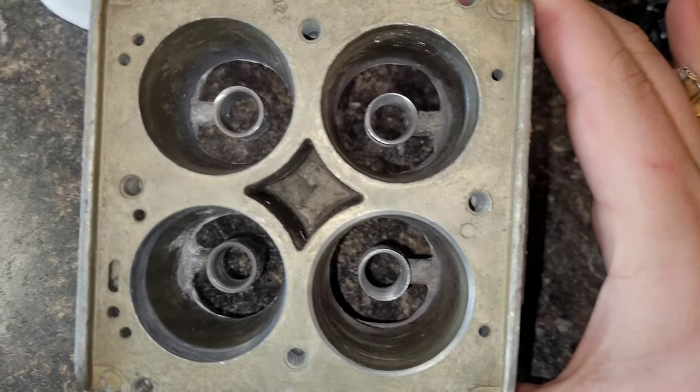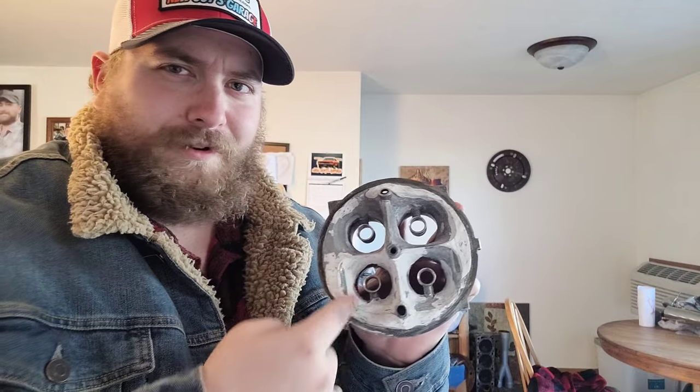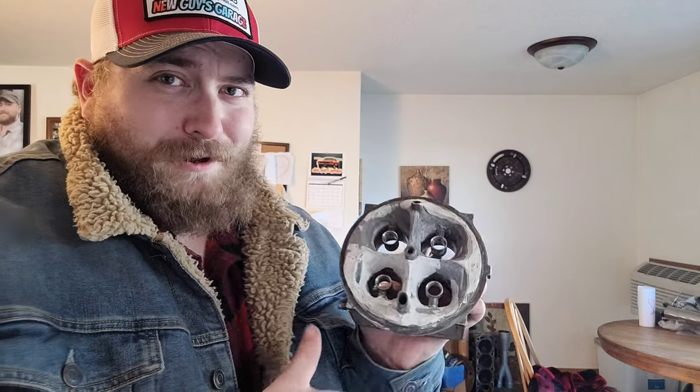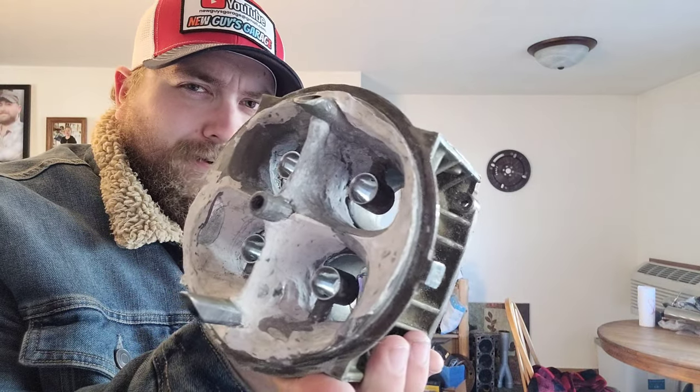In addition to working on the boosters, I've also kind of ported the entry a little bit. I still have a lot of work left to do — more than I was anticipating. I'm trying to get this JB Weld into a nice cohesive shape. Right now I'm cutting big and I'm going to go back in and refill, because frankly there are some spots that need refilling. It's going to look a whole lot better when it's done.